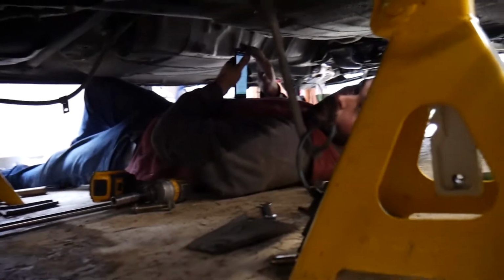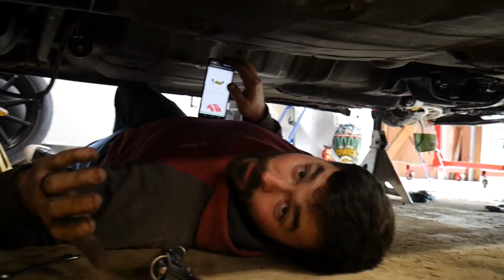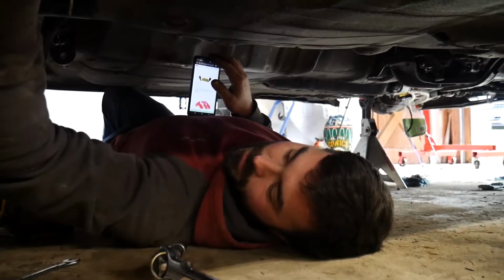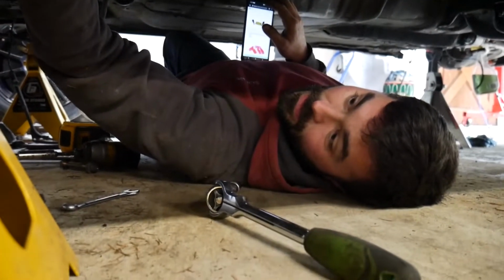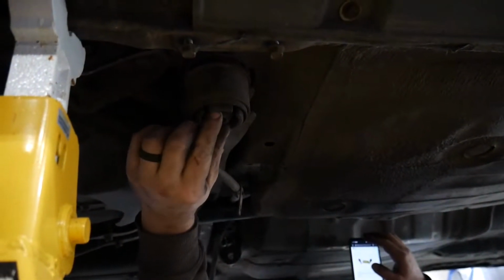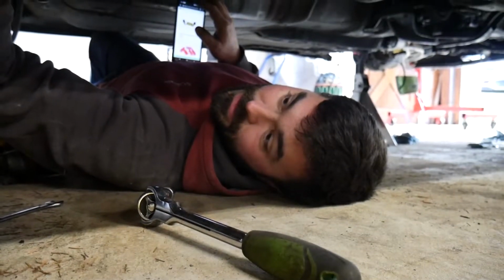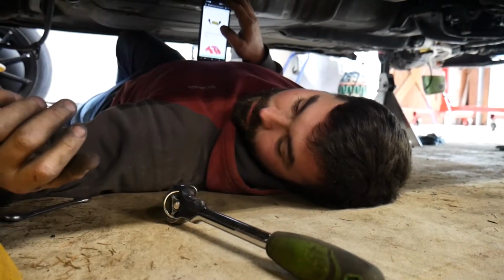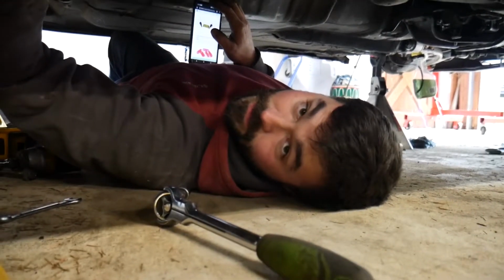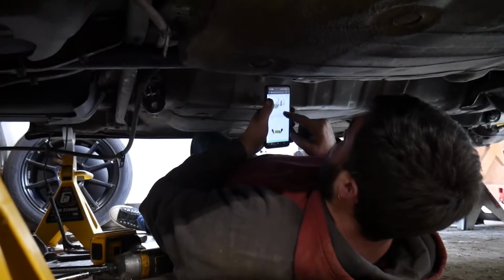Okay. Real quick, Mark, what are you doing? Oh, I'm ordering some parts. I probably should have just bit the bullet and ordered it while I ordered the rear subframe and the trailing arms, but there's this T-bar, which supports the front of the differential and bolts to the front of the car. This thing has a ton of flex and these super soft bushings, and they're torn around the inside here. So I just found a Whiteline kit and I'm going to order these bushings, so we can replace them with some nice stiff polyurethane ones. And maybe that will help as well, because this sucks tremendously. Like, this is terrible. So I'm going to continue and order these, and we'll see where we're at.